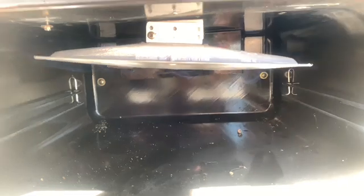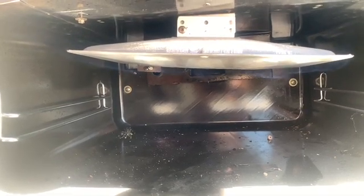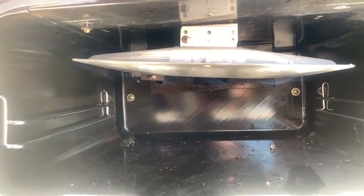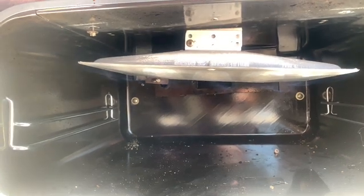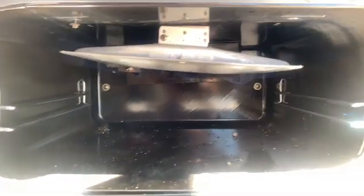Okay, yeah, that was nice and easy to light this one. Oh, there's some heat coming off it. Oh, yeah, Jesus Christ, that's hot. Turn it down just a bit. This will probably cook your toast in about 30 seconds flat. Like I said, I think the gas rate's changed because the restriction nozzle's out. There's a lot more gas than there normally would be, so the cooking times will probably change to this oven.